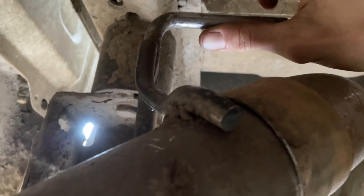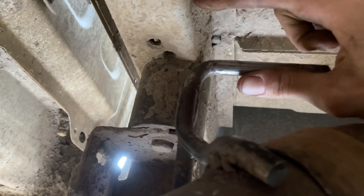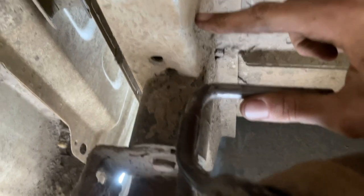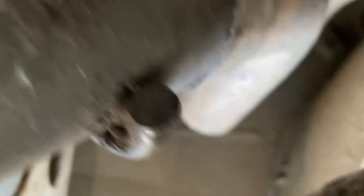If you look at this, we've got a hanger in the perfect spot. My plan is I'm going to cut out a hanger, drill a hole through here, stick the hanger in there, and weld it while it's in there so it's nice and secured. We've got a little adapter I cut to our stock piece that goes over the diff — I just cut the elbow out. It's all mocked up. From underneath you can see it goes straight out the side and right over — it won't touch the frame.